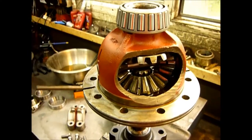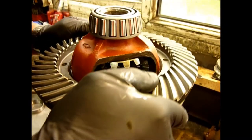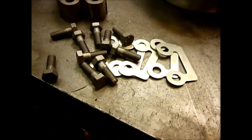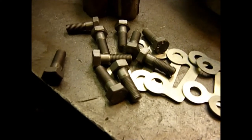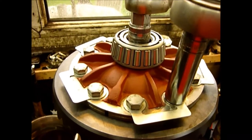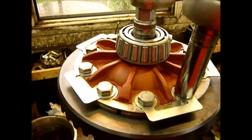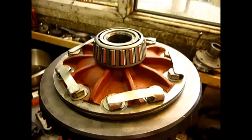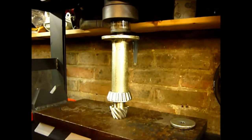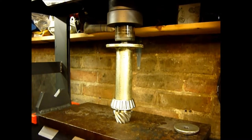Lovely when you've got a nice big press — it makes life so much easier, and it's better on the bearings than shock-loading them with hammers. So we've got a nice little building tool that we use to suspend them in mid-air — it also makes it easier to build. So now we're going to put the new crown wheel on. These ones are actually tabbed, so we've got new genuine old tabs and the original bolts, which have been aqua-blasted and frankly look like new. The crown wheel's on with all the new tabs. These are normally being folded on and off so many times they'll split, but the idea is they actually hold the bolts in place, because they're very low-grade and you can't really torque them up very tight. So these have all been torqued up, and we're now ready to fold the tabs over. Now we're pressing on the new, very expensive head bearing — nice tight fit.